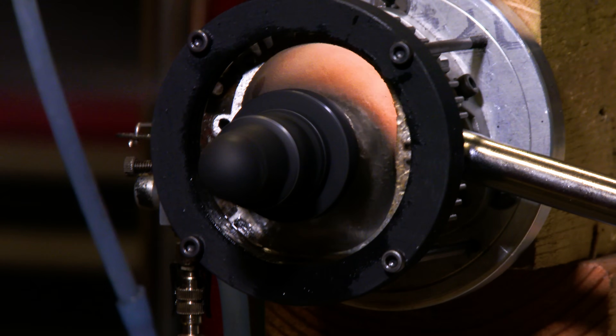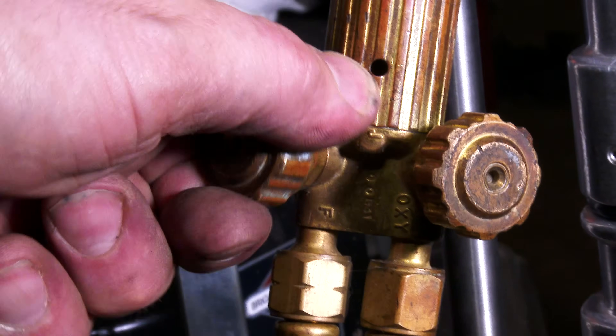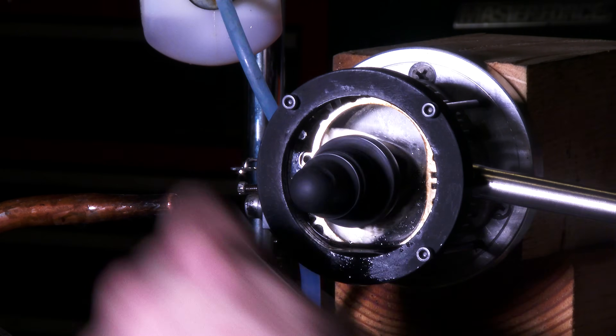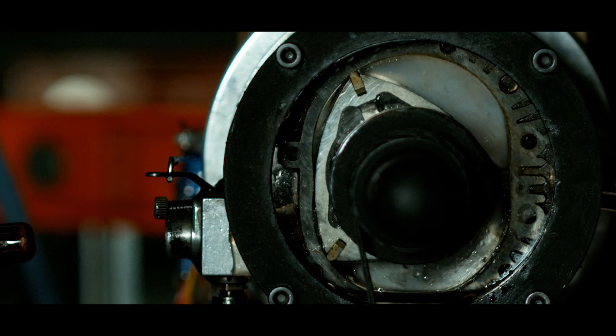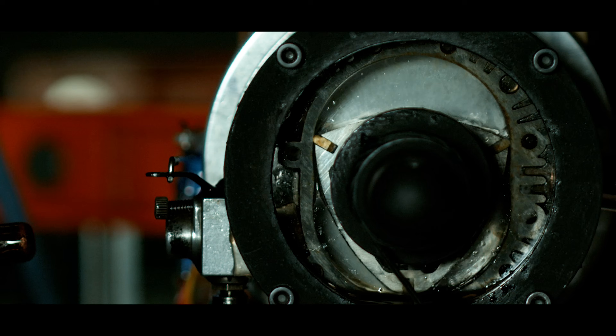Now that looked pretty cool but it was kind of hard to see the combustion process. So I'm going to run this engine again, but this time I'm going to lace the intake air with pure acetylene gas. This should beautify the combustion process and give us a really nice light show. The engine didn't start here, but this is a good example of how the combustion pressure pushes that rotor and creates rotational force.